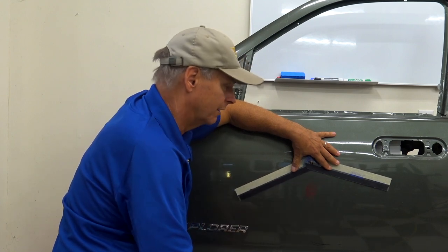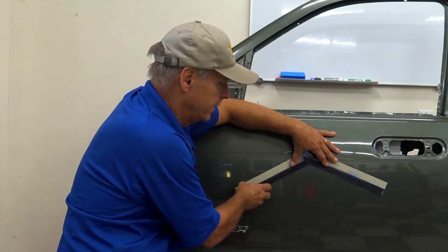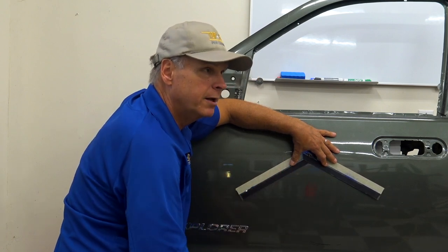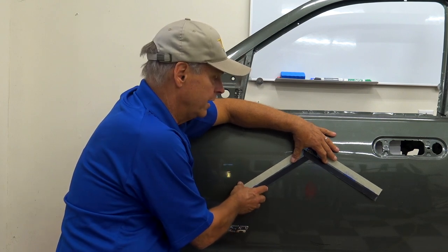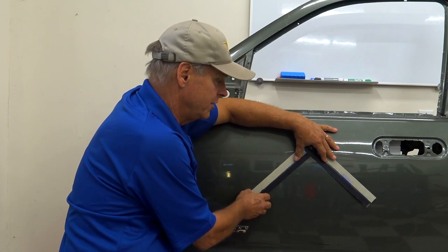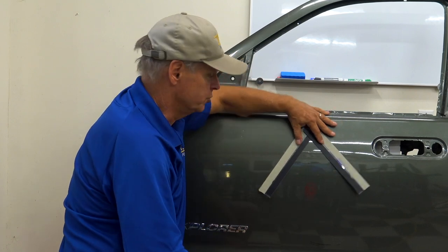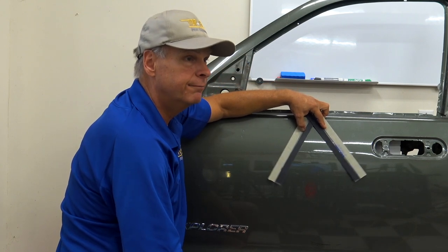It happens just about every time. Now to go from 130 to 110, okay, a little more of a crown angle, double the time again, double the amount of energy trapped in that crown. To go from 110 to 90, now we've got double the force again. And that's the way it happens, guys. Past a 90 degree crown angle, every 10 degrees you go, you double it again. So at a 60 degree crown angle, you've got quite a bit of energy locked up in that.